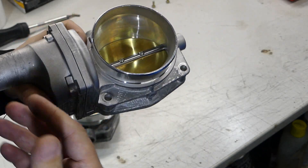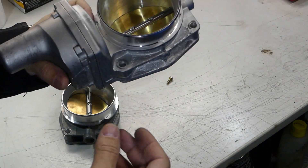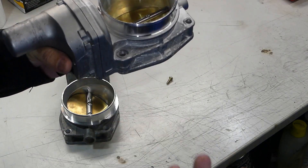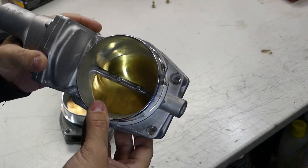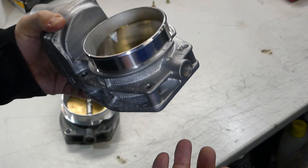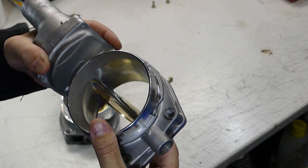We reset it, fired up, and the exact same thing happens. What's happening is it has somewhat of a redundant system in it — any time the throttle position does not match what the pedal says, that means something's gone wonky. We certainly don't want a throttle body to go rogue on us. The Haltech is a smart enough ECU to where it simply shuts the car off, which of course is what you'd want it to do.